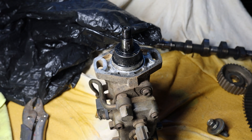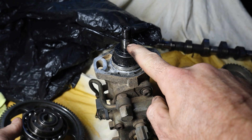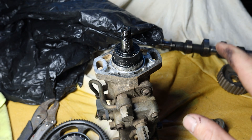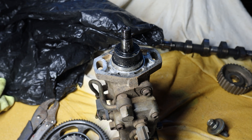Now, if you don't pay attention to that, what's going to happen is this gear is going to spin with the rest of the gears. But because that slot and that woodruff key aren't engaged with each other, everything in the engine will be spinning except the fuel pump, and then you'll be getting no fuel into the engine — and that is the quickest way to kill a diesel engine. Now, I don't want to panic you or alarm you or scare you away from doing this. I just really want to make sure you get it right. Pay attention and you'll be fine.